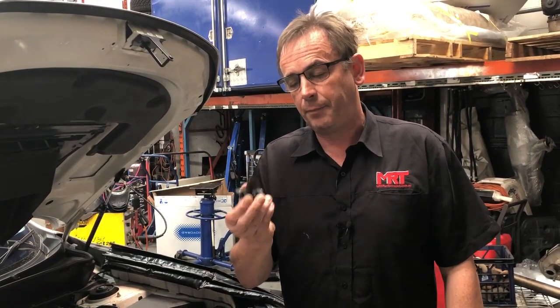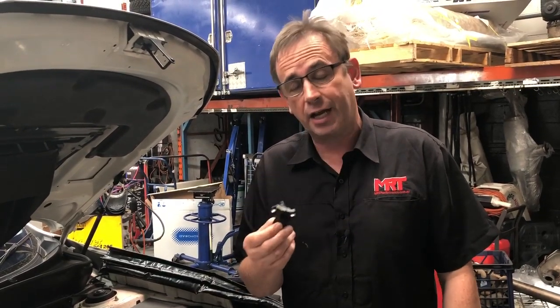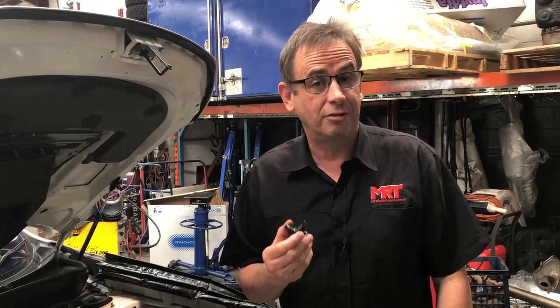One of them was this. Now typically it's very rare for a Subaru to have a fault with a MAP sensor on these cars — they are very durable. But what you can often get is a fault code which looks like a MAP sensor fault when physically the MAP sensor can't read the pressure itself.